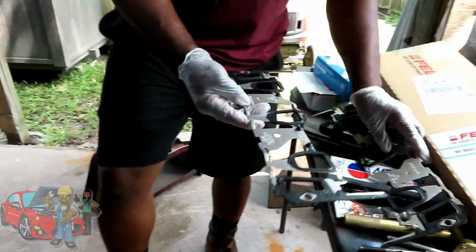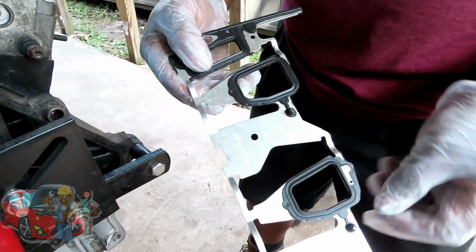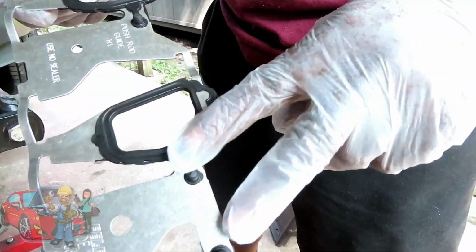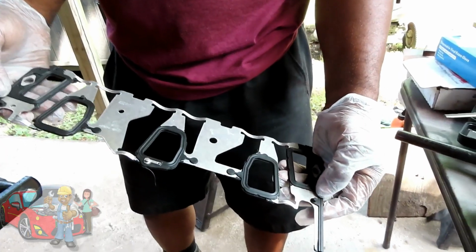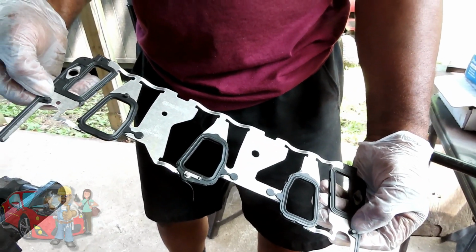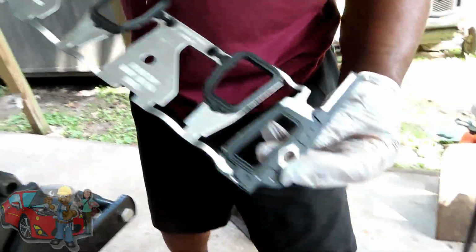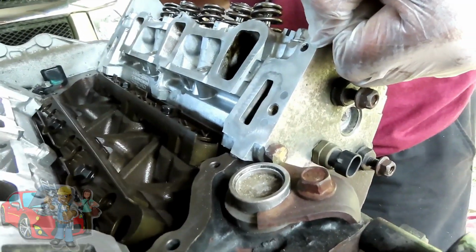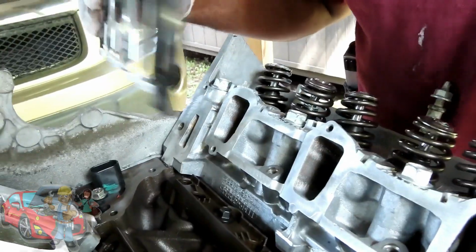Alright, so let's get this set up. Both gaskets are the same. Now, you're going to have two sides to this. You see these little alignment pins sticking out; those are going to face up to you. The part going to the cylinder head has two locating pins on each side, and there's a metal one right in the middle. So you're going to set it in. There's an alignment hole right here, here, and here, and that's going to be on both cylinder heads.